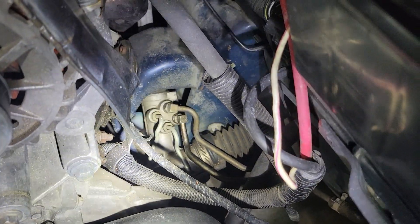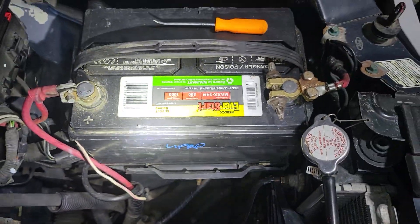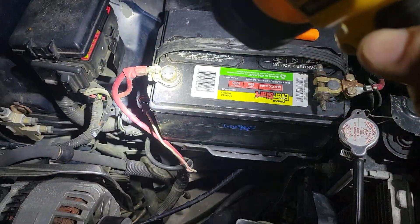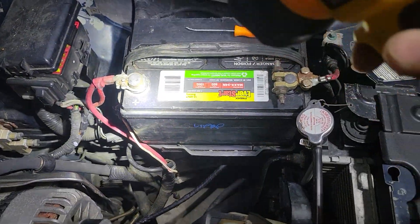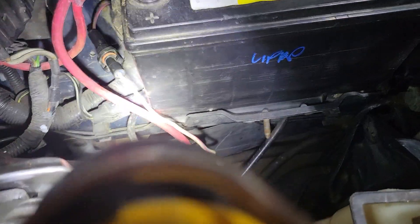This wire right here is from your starter — it's always identified by that hanger from the engine cradle to this big power wire. My battery is turned around because the ground on this side is really good to put a nice big three-ground right there, and having my power on this side makes it easy to hit my starter. Mine's just flipped, but it's the same as yours.